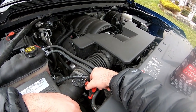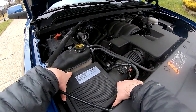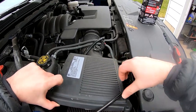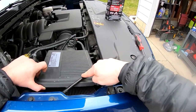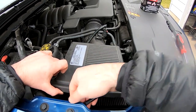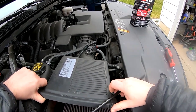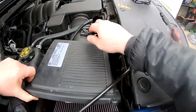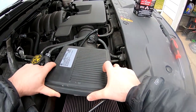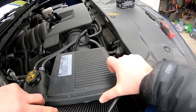It's not perfectly on the screw, but it unscrews. All right, we got all four screws out, so we're going to lift the box kind of straight up from the passenger side. There's a little bar that's kind of in the way — if you want, you can take that bolt out, but we're going to try to just squish inward with the corrugated air tubing. You can see the filter there — you should be able to just kind of sneak it out.